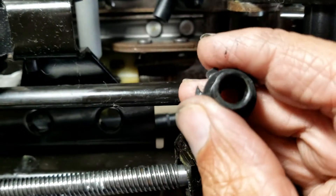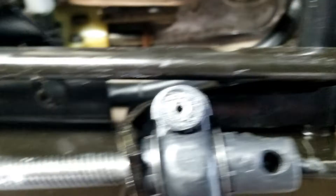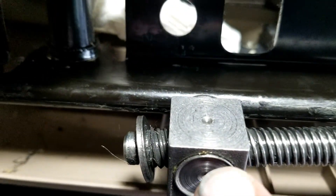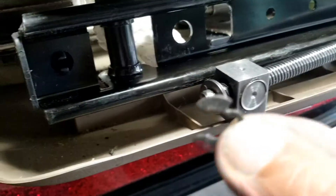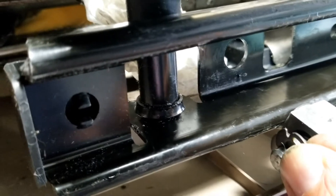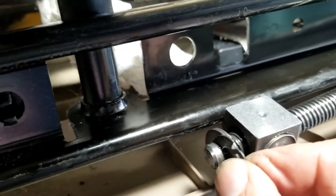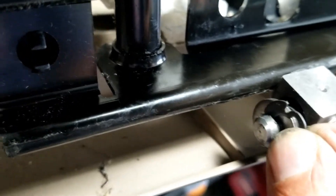This is the little plastic part that has to come off before this will slide out from underneath this rail — it's just a little plastic cap that comes off. It's what guides that axle, that shaft that comes off of the motor. It fits up inside here and goes into the little square on the motor. The shaft is through this metal bracket which is on a hinge, so it slides in and out. Then we have this block here, and then a thick washer, and then this little key washer.